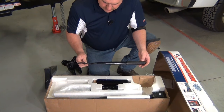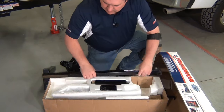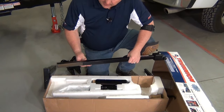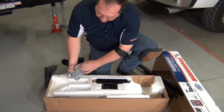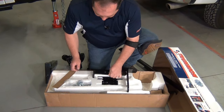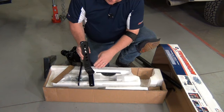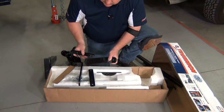This is called a snap-up lever — the idea behind this is a helper if you need a little extra leverage to get your spring arms up onto the L-brackets. These are the spring arms of the trunnion hitch; there are two of those, one for each side. The unique thing is the surface on the back — that's where you get the built-in sway control. That's the area that rests on the L-bracket and provides that friction point for sway control. You've also got your install hardware. This is the bracket that goes on the trailer frame, with two outside link plates and two inside link plates that bolt around the trailer frame. This is the L-bracket — it slides over the two studs and provides your friction sway control, and gives you the adjustability to change the weight distribution.